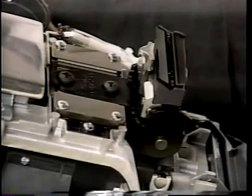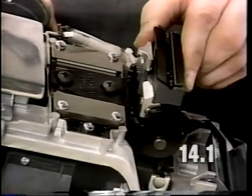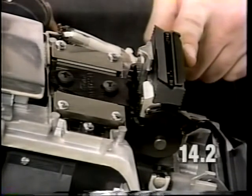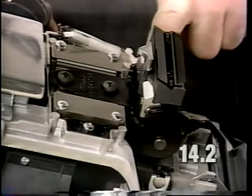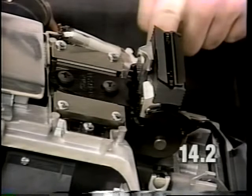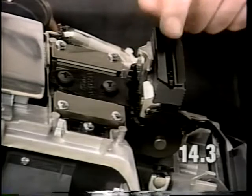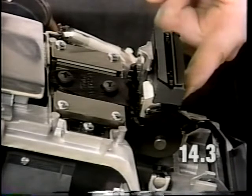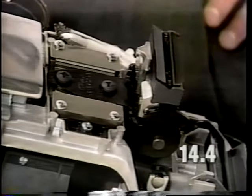If the unit runs away in either forward or reverse, check the operation of your slide as described in step 13 of the video. Also, make sure that the paper bag is not overfilled. If it is overfilled, the handle will not return to the upright position as it should. This will cause the machine to stay in reverse. Also, make sure your handle pivot spring assembly has the proper tension it should. When the handle is released, it should return to an upright position when tilted back.